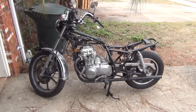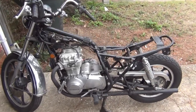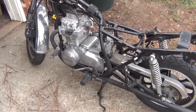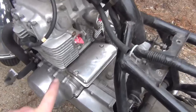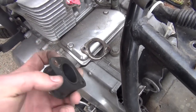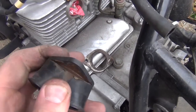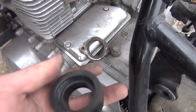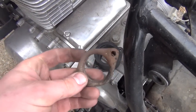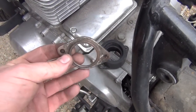Here's my dad's '82 KZ440. We've got it pretty much torn down from a lot of the loose accessories and body panels. We also pulled off the intake boots for the carbs, and this is what they looked like — we've got some splits in them. They didn't appear to tear all the way through, but this one shows what's inside that boot when the boot slips off.